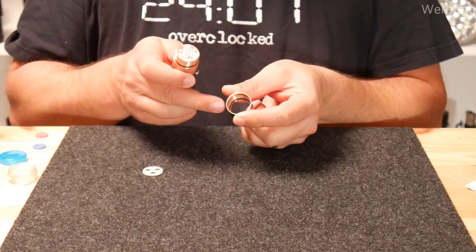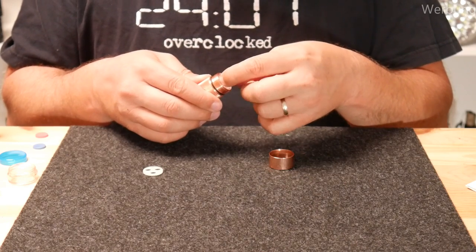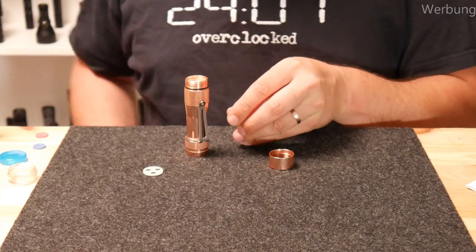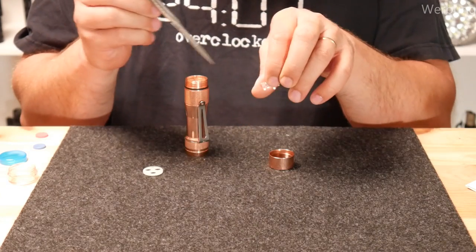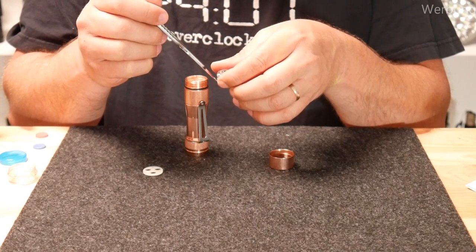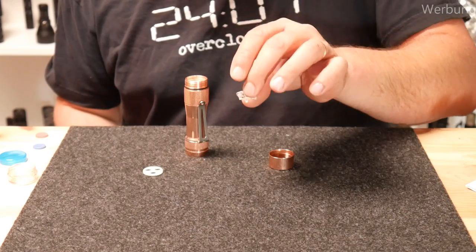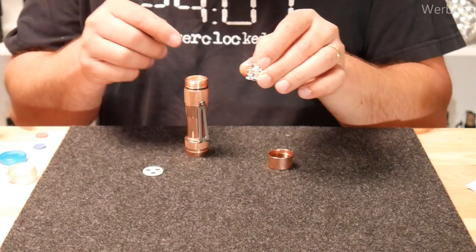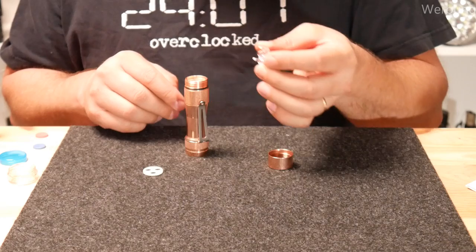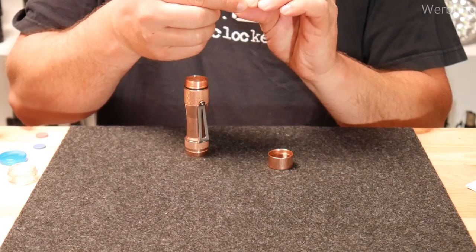Be careful that the lens does not fall out. Then you have the optics — you can try with your fingernails to pop it out. You can also use some pointy things, but be careful not to scratch. I recommend going into the area where the feet are so you don't ruin anything. The optics may stick a little bit because on the tiny feet there is some thermal paste.